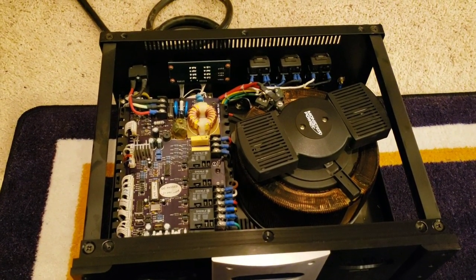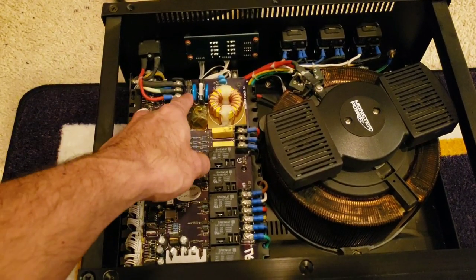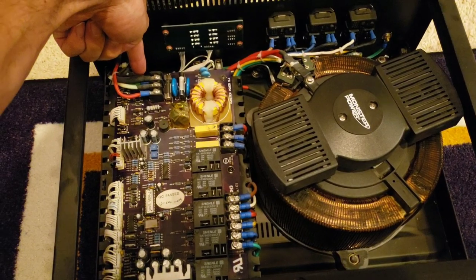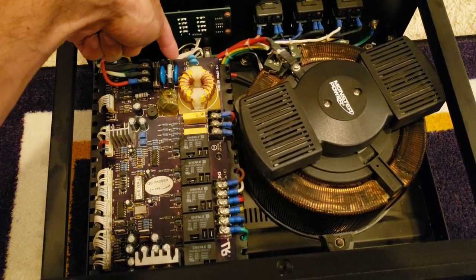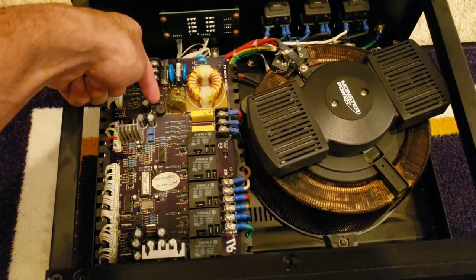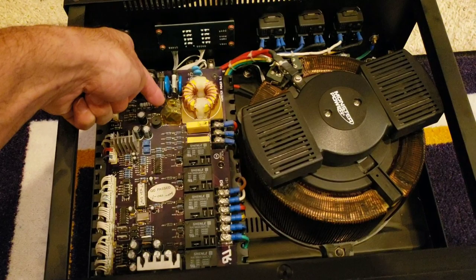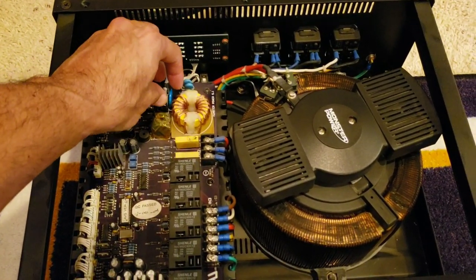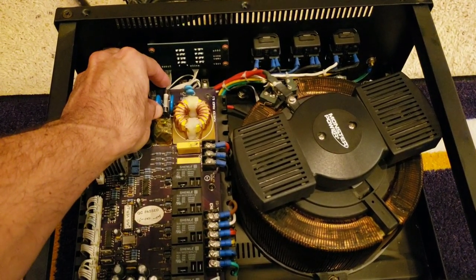What you want to do is replace a fuse. There are three fuses on here — there's a little one right back here, another one here, and a third one here. This one is the one you want to replace because the alarm is right here — this little black puck. Remove the orange tape off of this little clump right here, just like this, and there's a fuse right here in the middle.